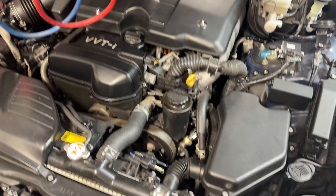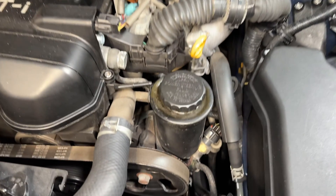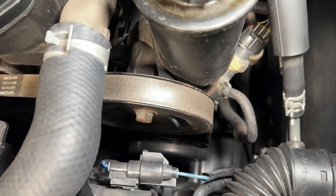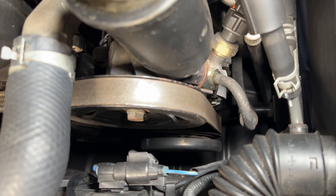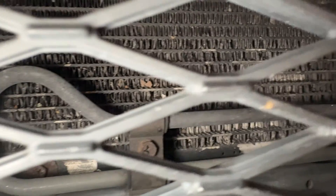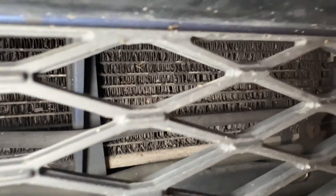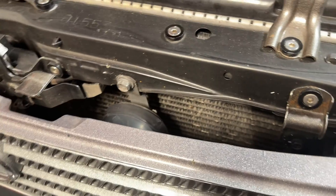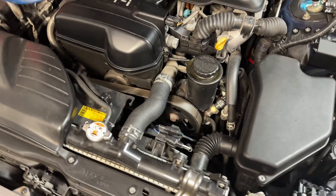The problem I had was I hadn't driven this car in a couple weeks. I started driving it and realized the AC wasn't getting cold — it was just blowing ambient air. I was expecting it to give out because this thing's a ticking time bomb. If you look at my condenser, it looks like crap — all the fins are pretty much torn out and broken, especially down where it gets all the rock chips. So it's been living on the edge with this AC system.